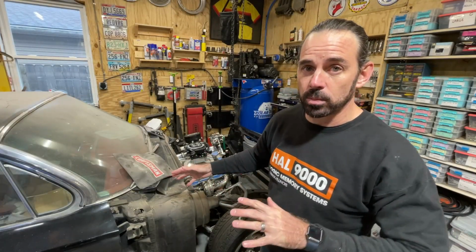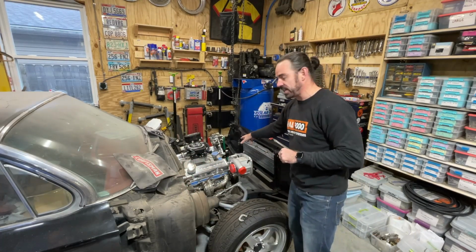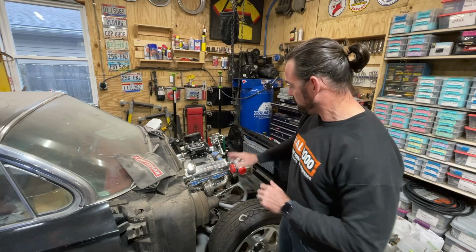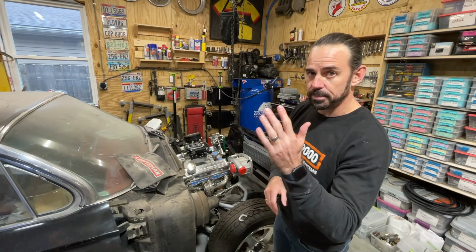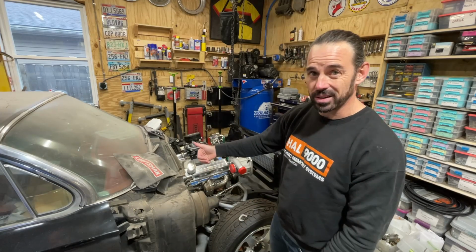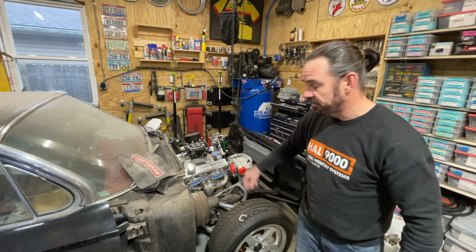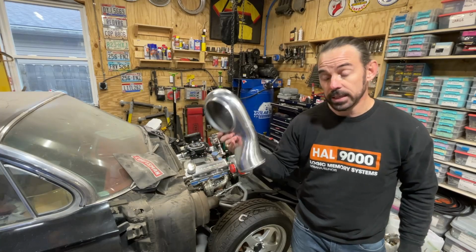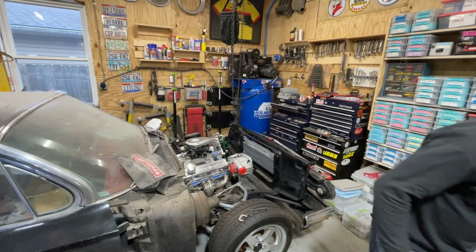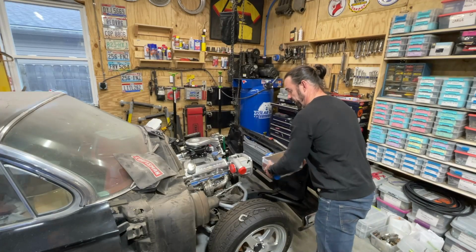It was a longer video than normal, but it's because we had a lot of things to show you. So we're going to get into some fixing of the water pump issues in the next video. I think I have a solution. There are some NPT adapters that can be bolted up to the block, and I think I'll be able to thread those in and save a few inches, which will get me out of the belt clearance issue. Also, instead of using the bulky inlet on the EFI, I found a low profile one. So I think this will work pretty well. And then, this is the new right angle intercooler, which we will install here in the next video.